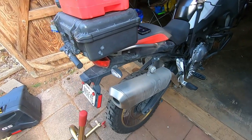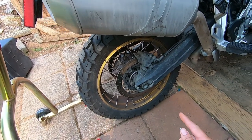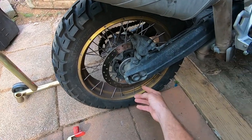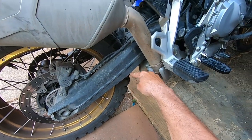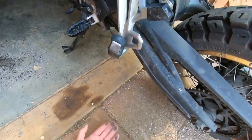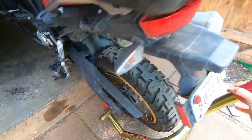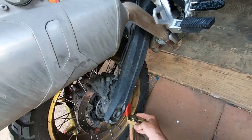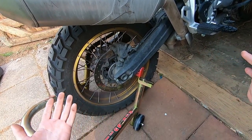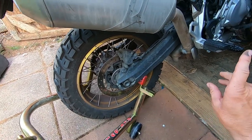I'm trying something a little different — I'm wearing a GoPro on my head, so I don't know if you'll be able to see what I'm doing a little better or not. The reason that this pit bull causes it to tip over is right here: you've got a pretty flat spot there, and then this part of the swing arm slopes way up. Coming over to the other side, the swing arm is flat pretty much the entire way. So if it just wiggles and gets to that sloped side, the bike will slide down, tilt, and fall over. That's happened to me once when I already had the wheel off — I was wiggling around on the bike too much, my fault.